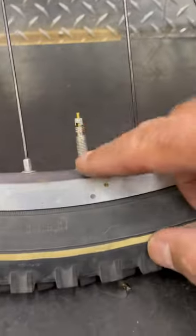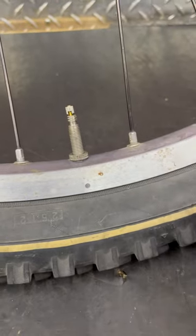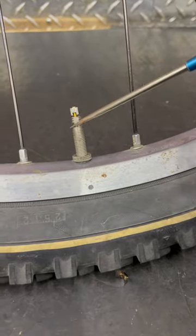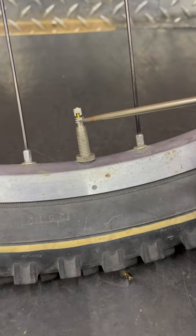You can replace your valve core in a tube or tubeless system. The reason you would do this is because you're getting a clog. The experience I was having with this tube was trouble getting air in, and also trouble getting air out.